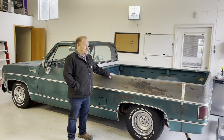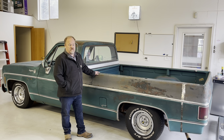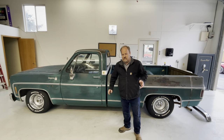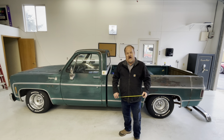Our next steps will be to remove the bed. I wanted to cut this on the truck like I did the back, but I don't feel comfortable cutting it with the fuel tank where it is — I'm a little afraid of fire — so I'm going to remove the bed first. We found something interesting on this truck. Obviously we're cutting this to a short bed, taking another 14 inches out of it, and it'll be the same dimensions as an original 79 short bed — 73 to 87 short beds are all the same length. These trucks had eight-foot boxes, which means inside the bed.